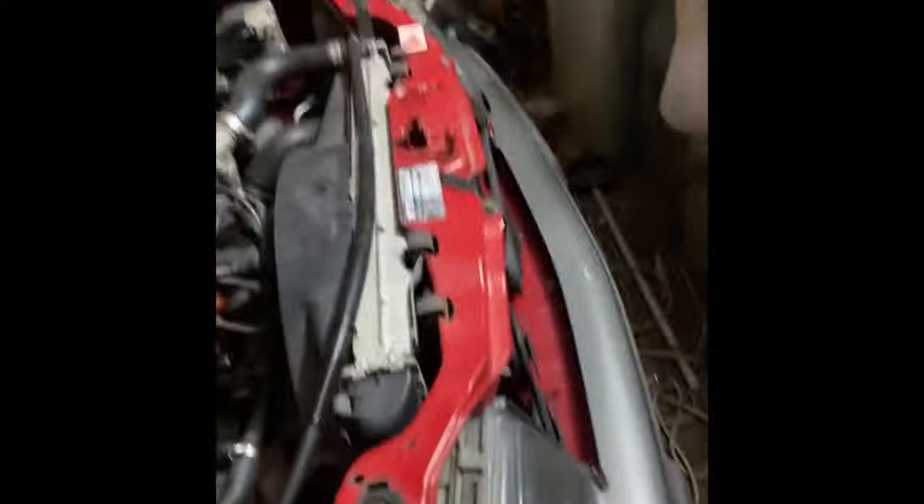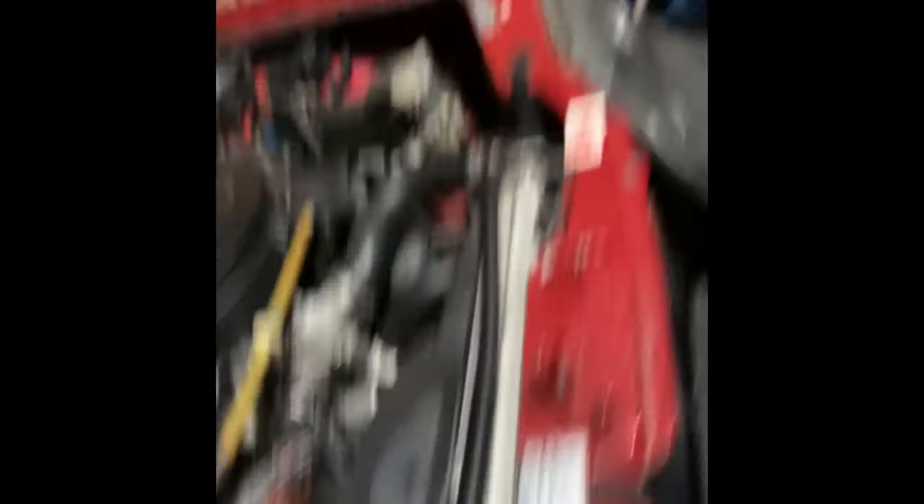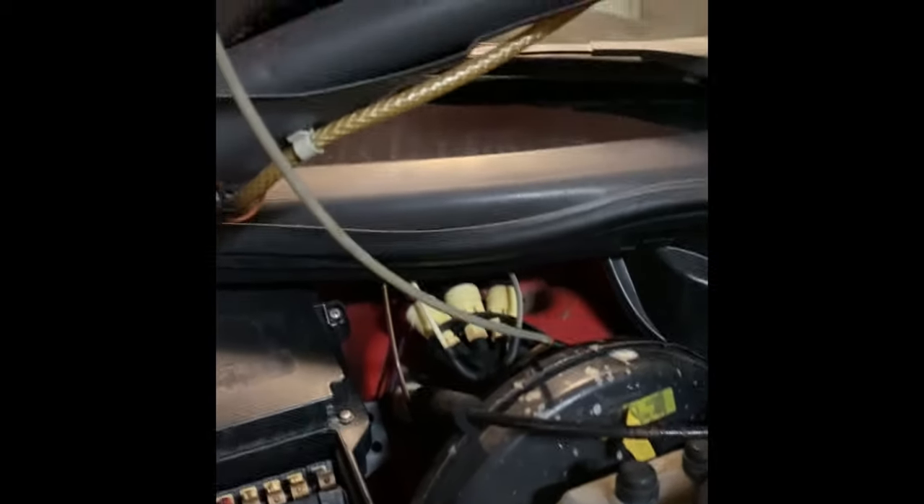My economy gauge, headrests, and lamp tilters weren't working on my w124 - they're all vacuum actuated and controlled with vacuum. I didn't fix the root cause leak. I found this white piece with two hoses - one taps off into one lamp and this hose goes over to the other lamp. This one's fine but the other connector - the nipple that plugs in - snapped off, so that's a leak. I bypassed that.